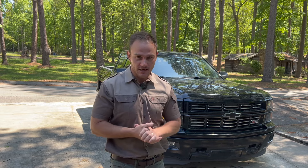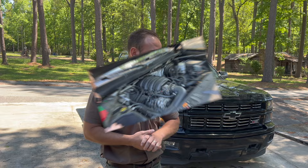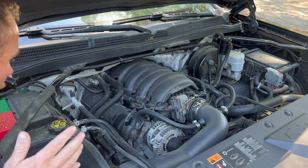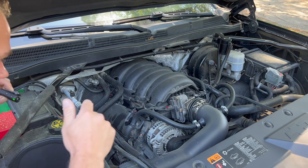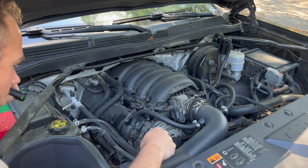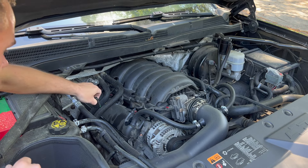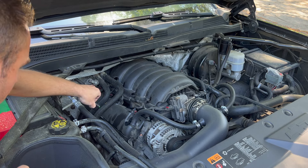We would only know once we find out, but I do intend to replace it anyway. I'm going to start the truck and let you guys hear that chirping noise. Hopefully the microphone picks it up — it almost sounds like a loose belt or something. I initially thought it was the belt, so I changed the tensioner, but the chirping was still there.